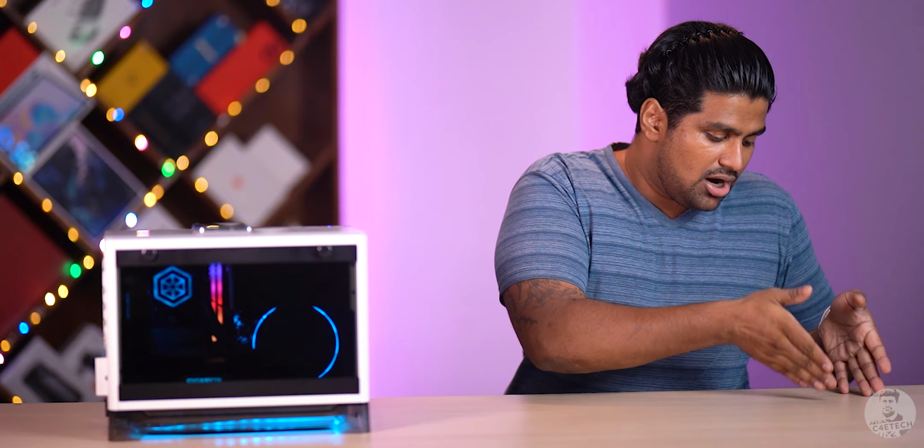I was extremely excited, especially for the last part, since, hey, we've got 10 gig LAN here in the office, and to get 2.5 gig LAN on this, I was super excited. But I kind of fell flat on my face, because we didn't really get 2.5 gig LAN on this. That's not a fault of the motherboard. Our switch basically has an option of switching between 1 gig LAN and 10 gig LAN. It does not run 2.5 gig LAN.